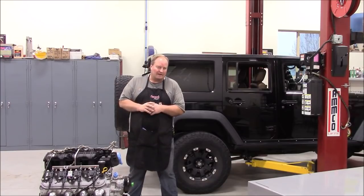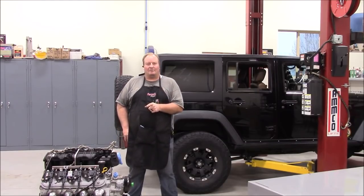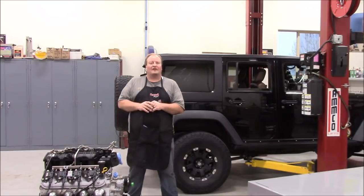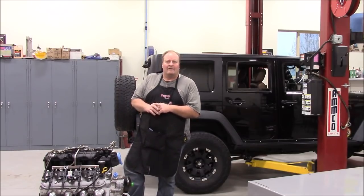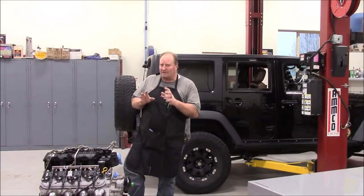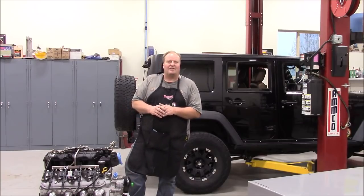I had a tough time finding one. I finally found a low-mileage L9H with 38,000 miles — my preferred engine — but the engine was already spoken for. I did get the transmission from that donor. Then I lucked out and found an actual L94 crate engine. They do not make this engine in crate format anymore — GM does not offer them. This is an L94, 400-plus horsepower — I think it's 403 or 404 horsepower, around 417 foot-pounds of torque. With a light tune, I'm told maybe 435-440 horsepower and similar torque gains.